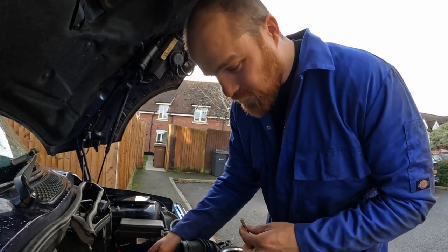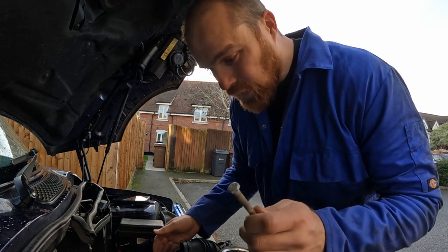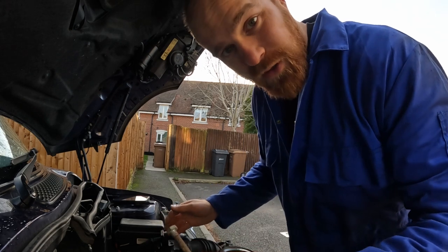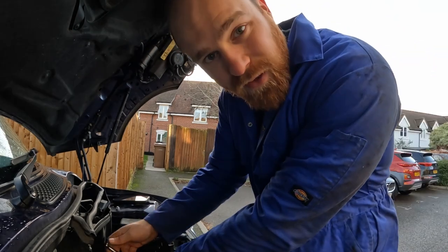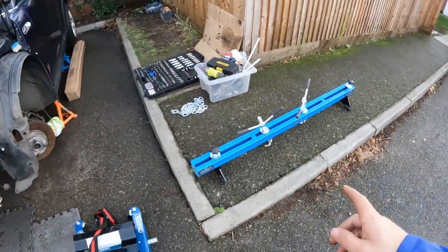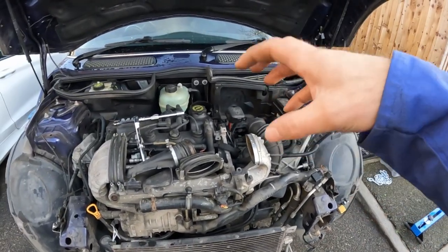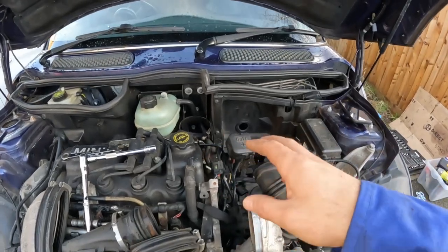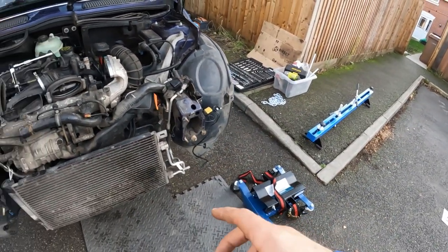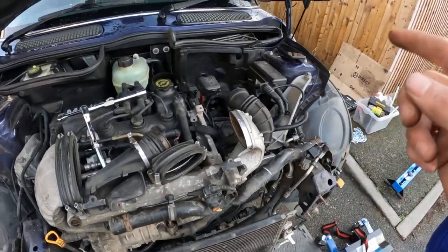It's day three — got rained off again last night. It's very damp, soggy, and cold, and incredibly windy, so please forgive any wind noise. Now it's time for nifty tool number two: I've got this engine bar. I'm going to string it across the top of the engine and use the chains to support the weight of the engine from above — the safest way to do this. Then I can undo the gearbox, take it out using the transmission jack, and gain access to the clutch and the rear main seal after I take the flywheel off.